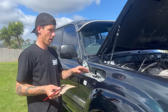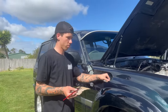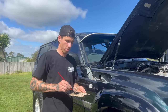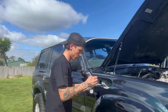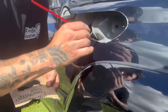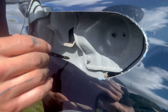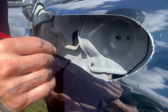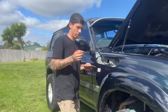Now that I'm happy with the cut I've pulled all the tape off, given it a nice sand so it's all smooth, and I've got some black rust-preventive paint here. I'll just go along with a paintbrush and neatly cover that hole on all the fresh cut metal, laid on thick. I'll do a couple of coats and then put the pinch weld back on and it should be sweet.